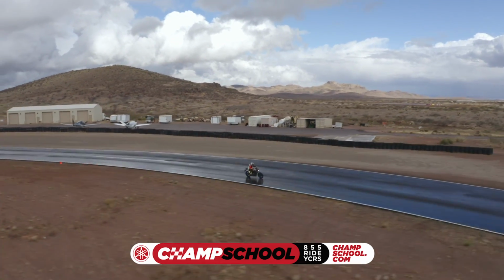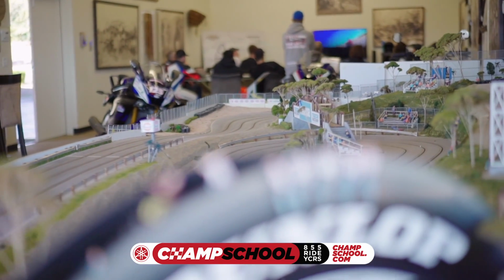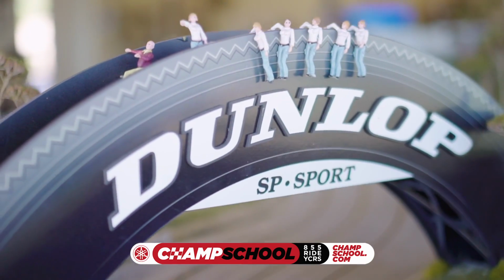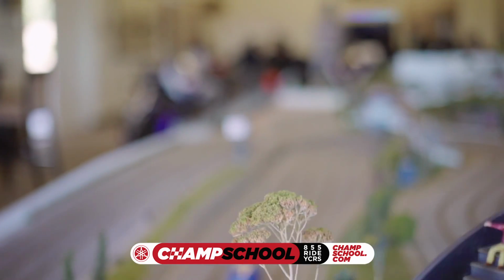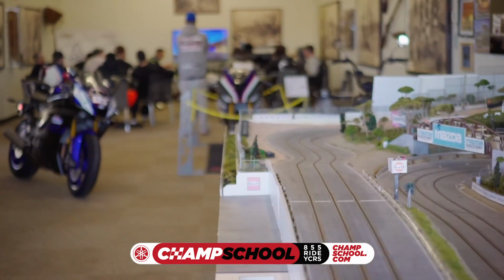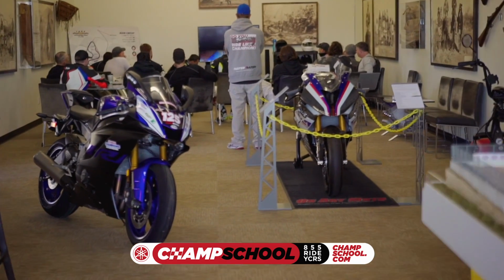If you are going to go out on a DOT race tire, be very, very cautious, because the siping, as you look at your tire, the siping ends as it goes onto the sidewall, and basically the edges of a DOT race tire are slicks, and the grip is very, very low in the rain. So if you are going to go out in the rain on a DOT race tire, then just realize that you cannot lean over onto that slick part of this non-siped tire.